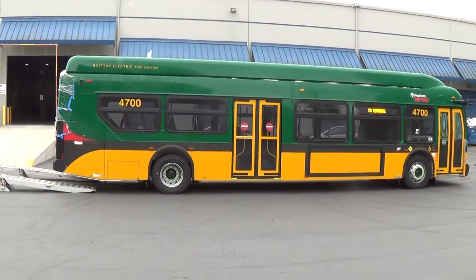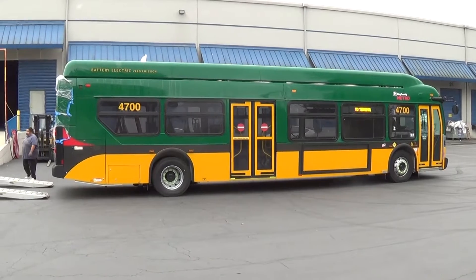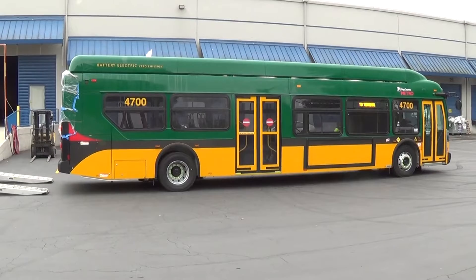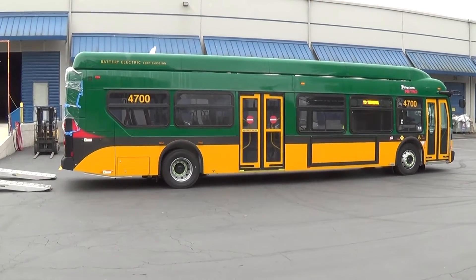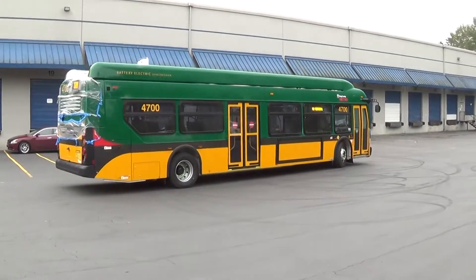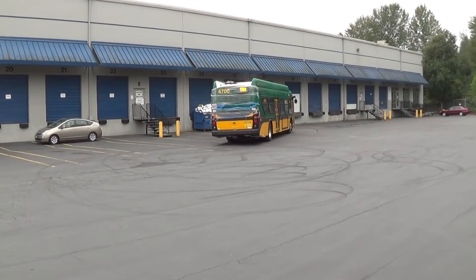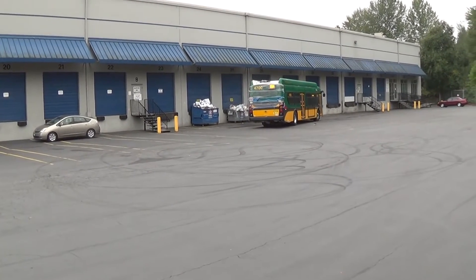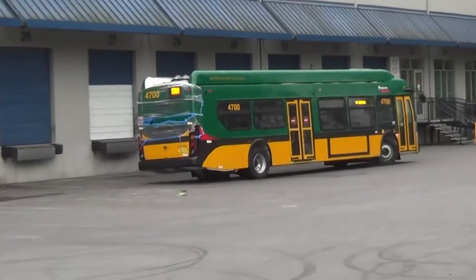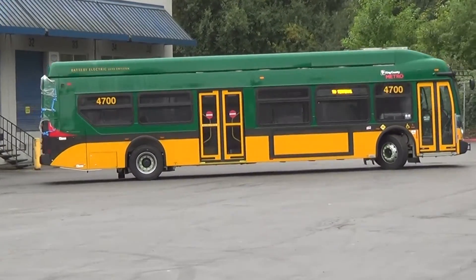From there, it's delivered to Metro at CSC, and they're going to do part of a pilot review. This is a pilot bus — one of the first out of the 40 build. They'll review the bus to see if everything has come into the configuration we want. Then we'll build a list of items to check from CSC's service preparations as they get the bus ready to go into service. It'll then go to Fleet Engineering for testing in terms of routes, range, charging, and other things to make sure everything's operating the way we need.